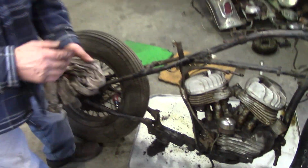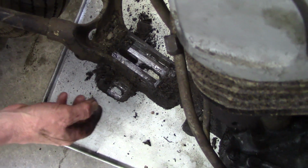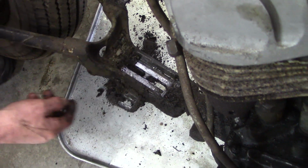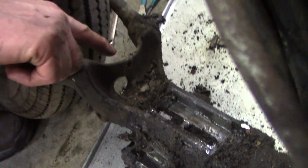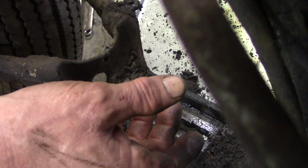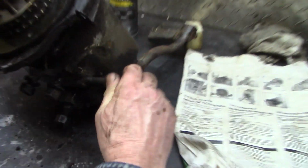Transmission has 3 bolts. There's studs coming out from underneath, and you see one going here, one going here, and then one's under here. There was a previous transmission that only had 2 bolts. This third one stiffens it up better. But see this hole right here? That's how you would be tightening up a bolt, and it would be pushing the tranny forward, or you'd have to pull it back. Look at this bolt.